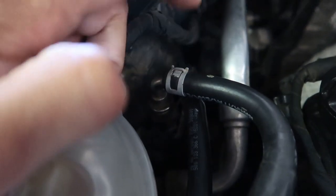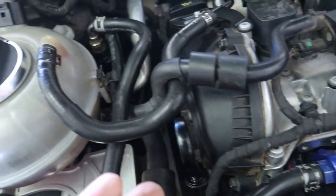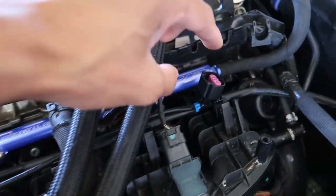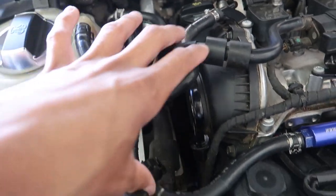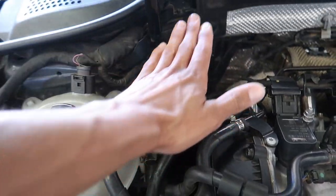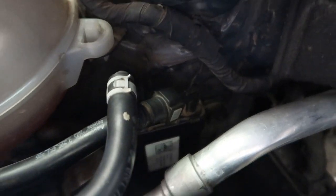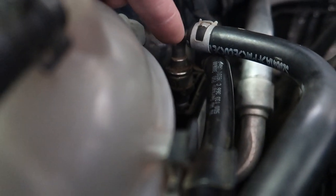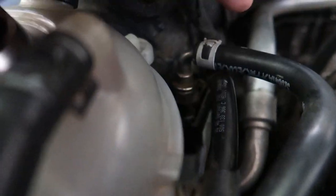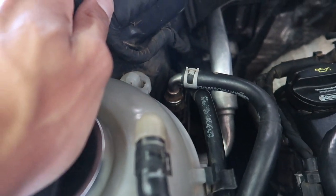This line right here goes all the way back to the fuel pump and then comes up and goes into the fuel rail, while the ethanol sensor is going to sit right about here. I got the connector already ready to go, just zip tied down since it hasn't been in use. There's a hard line after here and it's pretty restrictive, so this fuel line should really help on the fuel flow side — especially if I want to run full E85 with this EQT Vortex whenever it shows up.